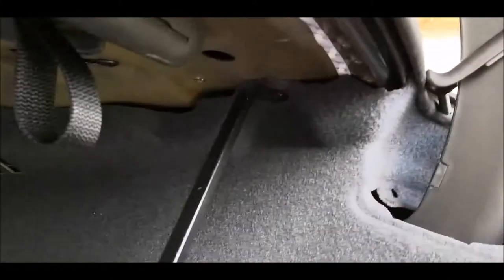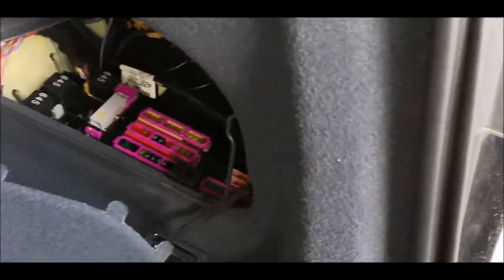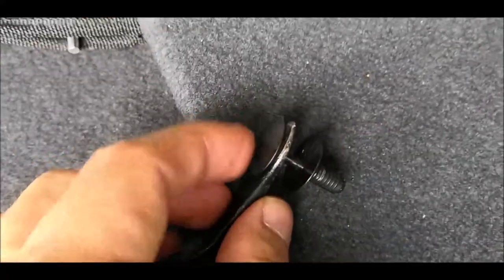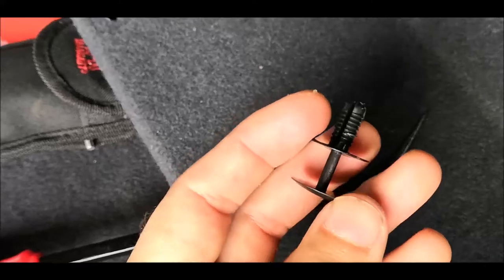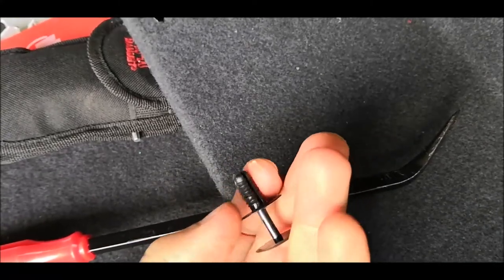Carry out the luggage trim removal, we'll have to take out one, two of those pins which are here, and then this one which was there, and then take this part aside. This is how those pins look like. So all you have to do is to stick something here in between, and to pull it out, so that this one will come easily out, because the only one which is keeping it stuck is this pin. So if you remove the pin, then this one should come off easily. And then is the second one, which is right there.